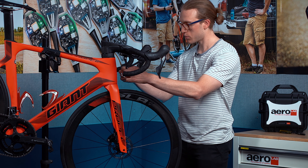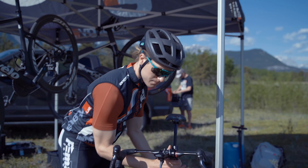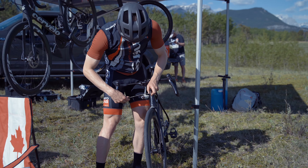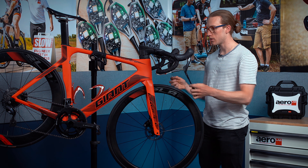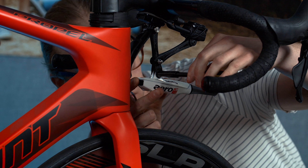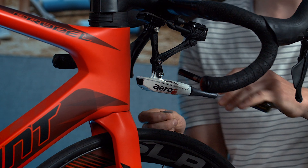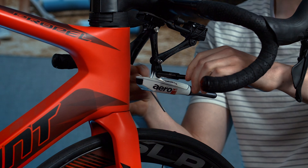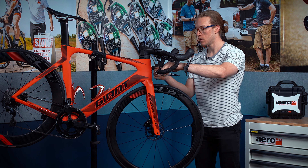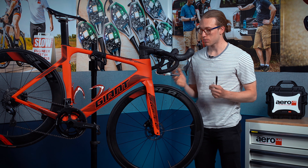Take the nut and put it on the end. Now that the sensor can move and all the mounting hardware is on, make sure the bike is on level ground. By eye, just make sure that the pitot tube is level to the ground and level to the motion of the rider. Use the socket to hold the nut and the allen key to turn it, then look and level the sensor. Finger tighten the bolt — nothing excessive. Everything here is made of plastic, you don't need it to be overly tight. Just with the ends of your fingers until it becomes difficult — that's probably enough.